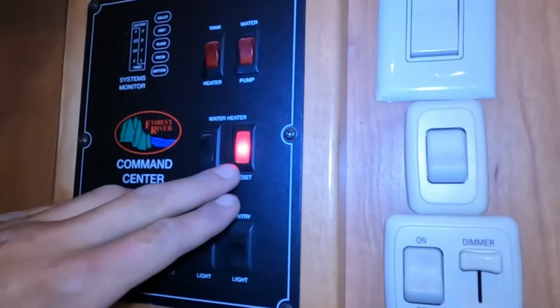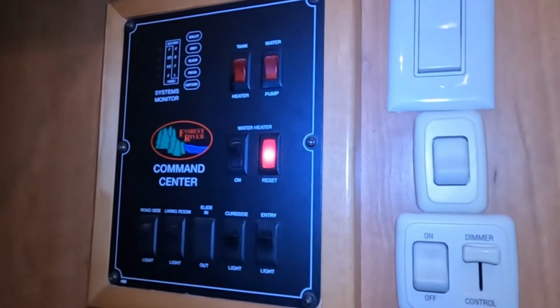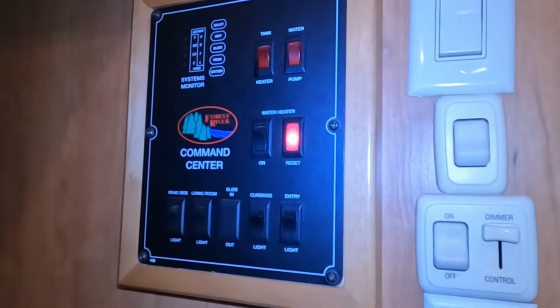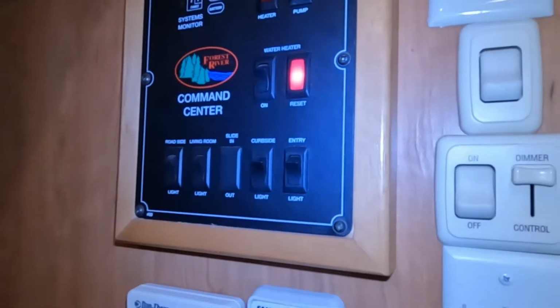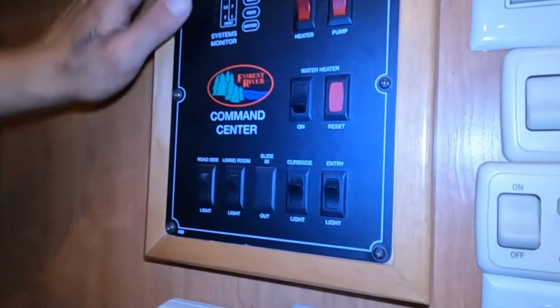As you turn that button on right there, you get that little light letting you know the ignition sequence will start. Once that sequence is started, that light will go out. It'll try that 3 times. If after the 3rd try it hasn't fired up, it's at that point you go and use that reset button that we'd shown you. Stood right here, you can hear the click of the igniter, the whir of the flame. We know that tank is good.